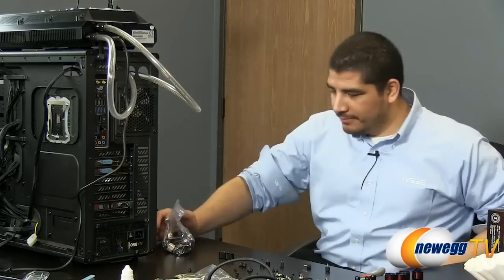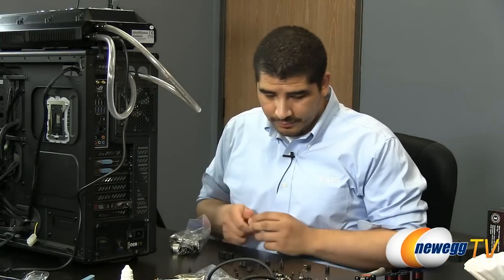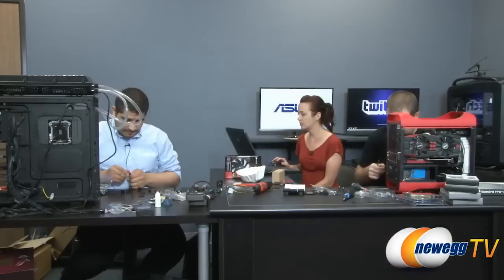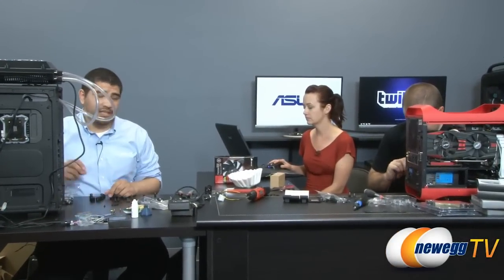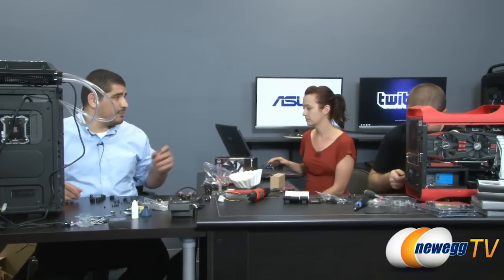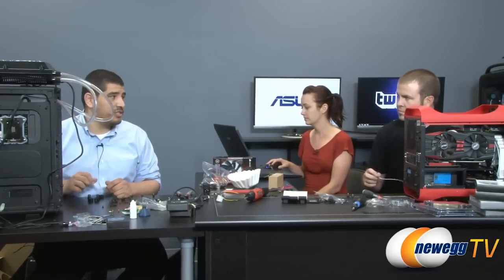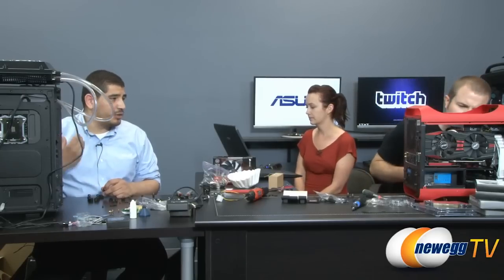Okay, what would be the best entry-level Asus sound card to replace my onboard audio to pair up with the Logitech G230 headset? Forgive me guys, I'm too sick. The Xonar DGX, man, for the money, on Newegg you can usually get it for like 30 bucks. It's really inexpensive. It's got a really good isolated power delivery. It's got a nice punchy little op amp to it, which gives a nice bass range extension. Gives a little bit louder gain levels too,